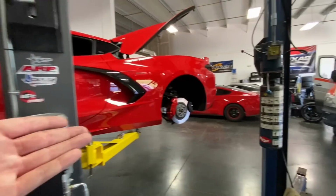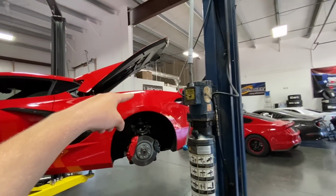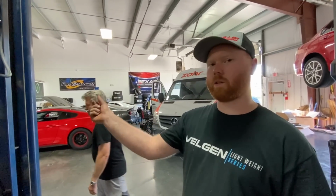And we lowered it. It's lowered now. Steven, we need some tips. What are some tips for people trying to lower these the quickest? To lower the back, just take the shock loose, so undo it from the top. Yep. 3 bolts on the bottom, 3 nuts on the top, and then the bolt for the sway bar link through the knuckle.